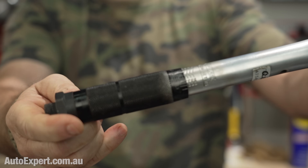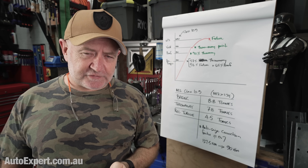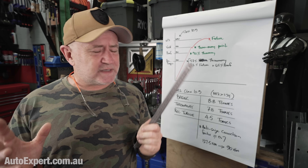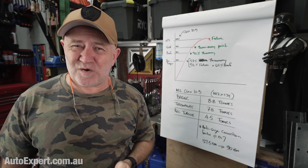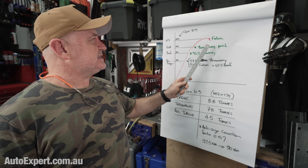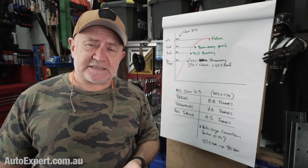As a customer, I'd be a complete hard-ass about this and demand that any workshop I pay actually uses a torque wrench. I would not do business with a shop that brushed me on this issue. If I got home and those studs were over-cranked, that would be a relationship ender. I'd check them when I got home and if you've got the tools yourself, just crack them open a little bit loose and then re-torque them to spec. I really do want to give you that degree in ghetto engineering after which you've always lusted.